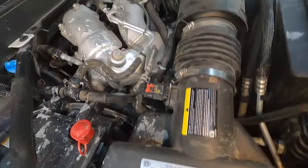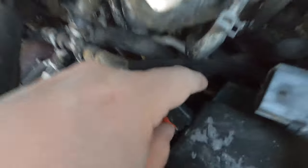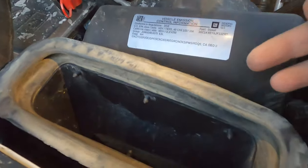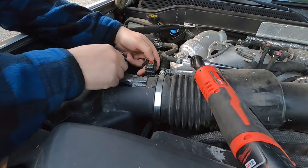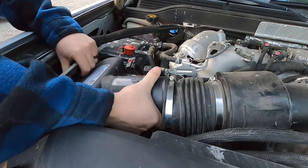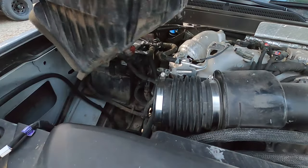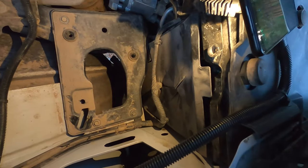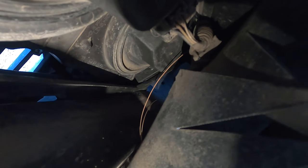For the passenger side I've got to disconnect the mass airflow sensor. There are also a couple of hose clips back here that hook into the back of the air box to hold the coolant line and the airflow sensor. Take off this clamp and then the air box actually just pulls out. For this I'm just using an eight millimeter — don't take it all the way off, leave it a little loose so you don't lose it and it's easier to put back on. Took the harness off, got the connector off. This guy just pulls up — it's a little scary. Just watch your cool lines and everything. So once that's out you've got some room. The high beam and low beam are behind the shroud, so get yourself a panel popper and take out these Christmas tree fittings. Then you can see the high beam down there and we'll get that one installed.